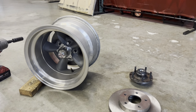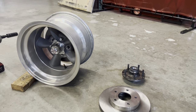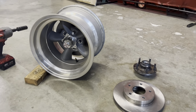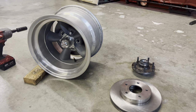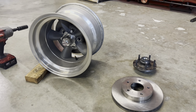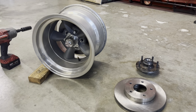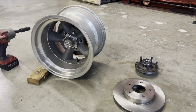I love a Tri-5 that's got stock track width and is hammered down in the front, tucking the front wheels and tires. I just think that's a killer look. So to go about that with a decent budget, I could order the CPP zero offset brake kit. I just ordered one for another customer, and it's probably $500 to $550. It gets me a 2-inch drop spindle, and it keeps the factory track width. But I really hate to go about doing all that when everything I have is already decent, and I can just keep running the spindles and stuff that I already got.